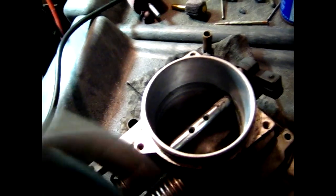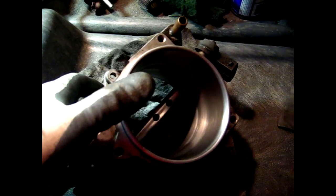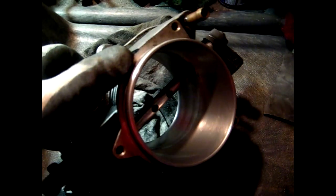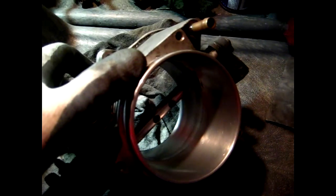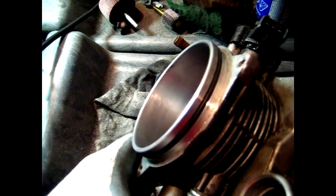If you have a little more room inside you can get a Scotch-Brite attachment for the drill. However since I still have the shaft in, it is hitting on the opposite side so I can't get it in fully — I may resort to doing this by hand. Just like sandpaper you can use some water with this for a nice fine finish. I started with the green pad since it is coarser than the red, and once satisfied I moved on to the red pad which is a very fine composition. You can see it has somewhat of a brushed finish on the inside of the bore.